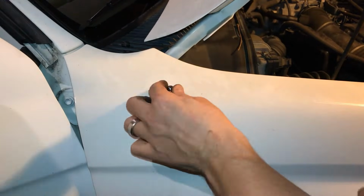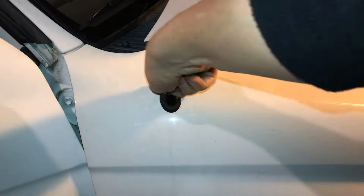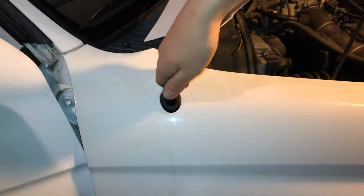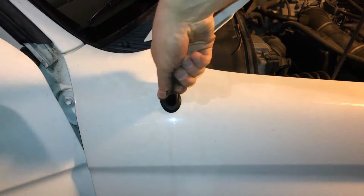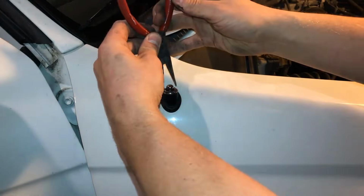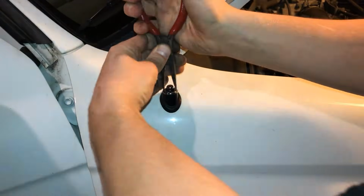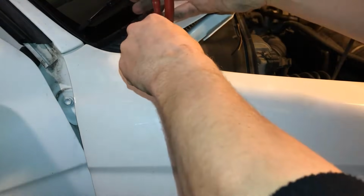Unfortunately, if there is some sticking up, at least on this 4Runner, you'd have to take the wheel off, take the wheel cover off, and then take the mast assembly completely out, and there might be a plastic piece of the old mast still stuck in the wind-up reel. Fortunately, that's not the case for myself.